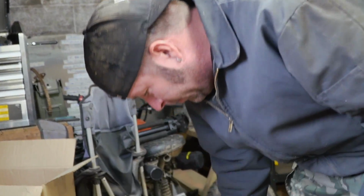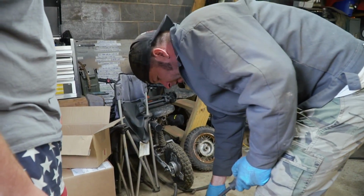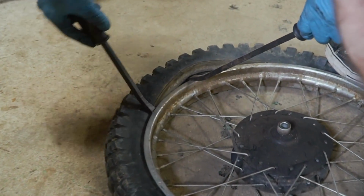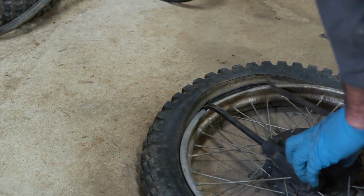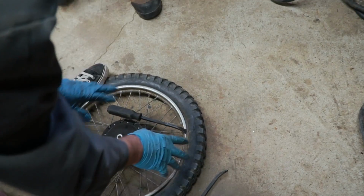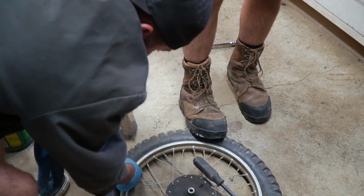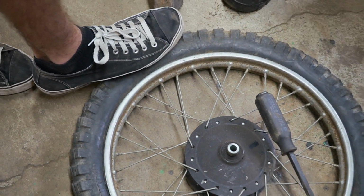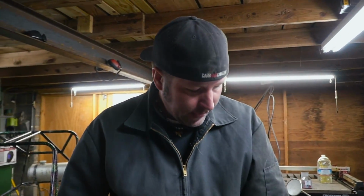All you got to do, buddy, is stand on this tire just like this. All right. Bring that thing over like this. And you start working it down. Yep. Work it. See, I started it. You can finish it. Step on that. I like stepping on this because you see this little bit of a groove here. If you have it pushed down to that groove, it allows it to kind of fish in some. I got you. You got it? Give it a shot.